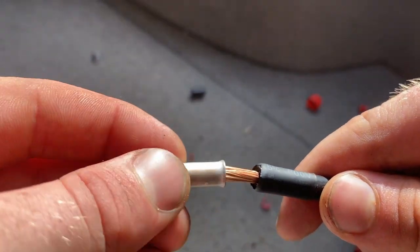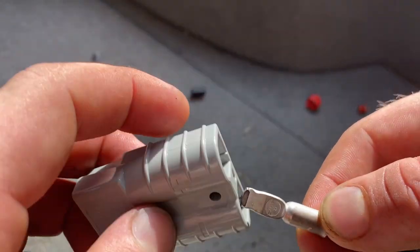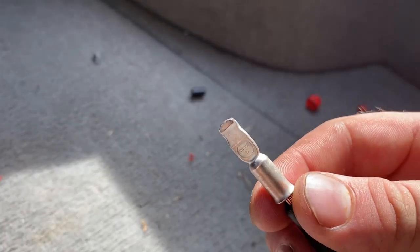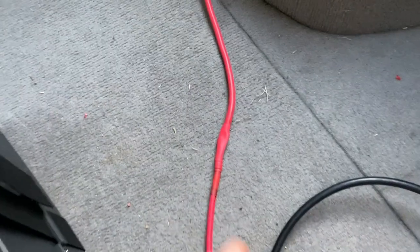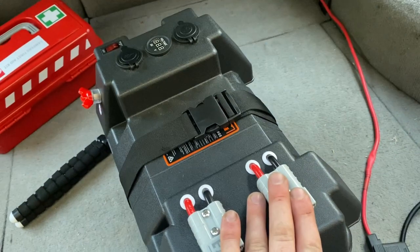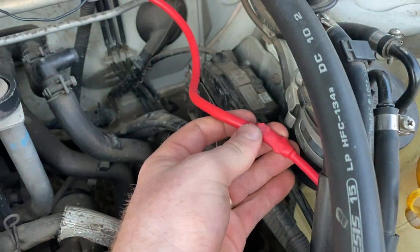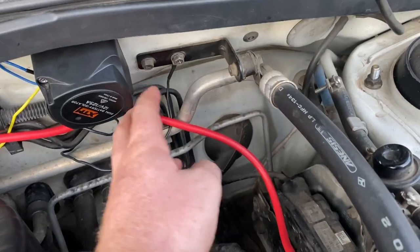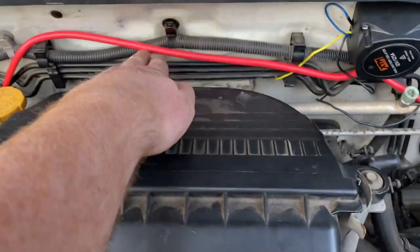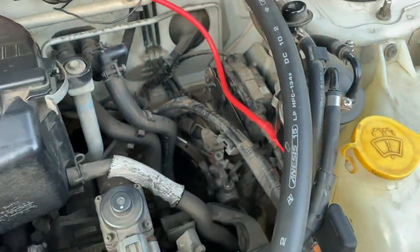What we've got now is I'm just about to connect the Anderson plug. So we've got the Anderson plug going in this way and then it'll connect to the battery. Rather than having bare terminals on the end I've changed it to an Anderson plug - we've still got our fuse there, and I've fixed up this connection. That Anderson plug can just go directly into the battery box. At the front we've got the same thing - fuse and a redone section with a butt terminal the whole way through. The reason it looks spiky is because I've crimped it down - the wires aren't going anywhere. Heat shrink on there, straight to our voltage sensitive relay, and then through the firewall. Still need to cable tie that along with the main positive lead, but that's it!